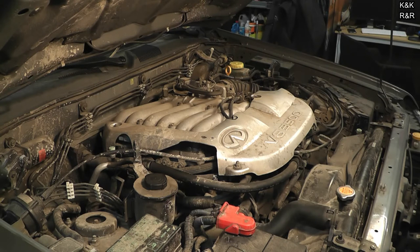But if you don't get to little problems, they become big problems. In the last year or two, we've noticed an issue with a weird ping, terrible gas mileage. A lot of people on the channel report that gas mileage is terrible in these — we get about 210 miles out of 16 gallons. The cooling system is running cold, and part of the fuel economy issue is the intake that we're going to tear apart — it gets leaks. The engine has to dump more fuel to make up for it. I believe we have an intake manifold vacuum leak, because the pinging means we have a lean condition — fresh air getting into the engine not being accounted for, since this is a mass air flow engine.